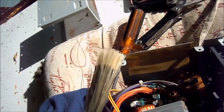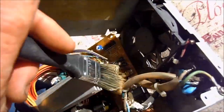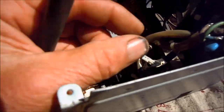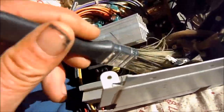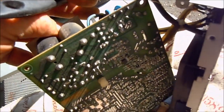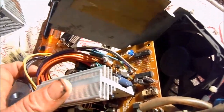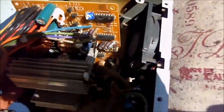If you don't have alcohol, get a paintbrush with good stiff bristles and just get all this dust and crap out of here. The fan came disconnected when I was pulling this out to look at it. You can get it fairly clean by just brushing all this out. You might be able to bring this thing back to life — just make sure to get any of that dust that looks like it could short out of there. If you have compressed air, you can blow it out as well.